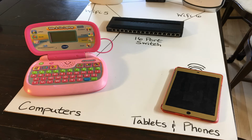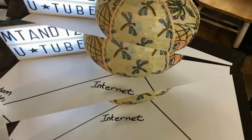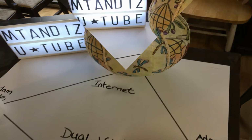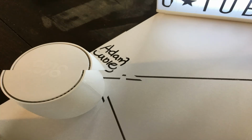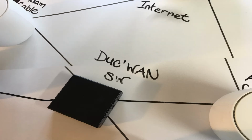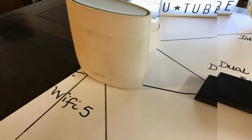Wired Ethernet ports. Plug in computers, game consoles, streaming players and other nearby wired devices with 1 gigabit Ethernet ports in the router and 4 gigabit Ethernet ports in the satellite. Safe, secure and loaded with advanced technology. Designed with MU-MIMO, Smart Connect for one Wi-Fi name, and beamforming technologies. Supports WPA2 wireless security protocols, includes guest Wi-Fi access, DoS, firewall, VPN and more.